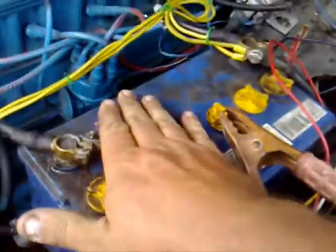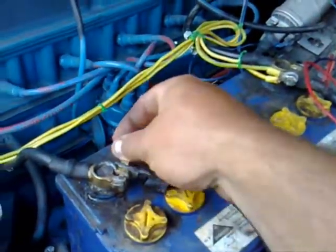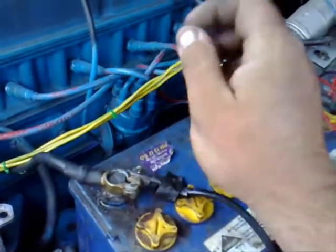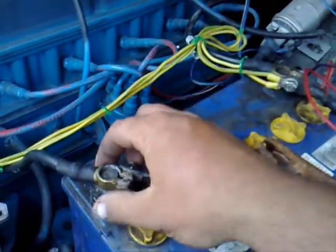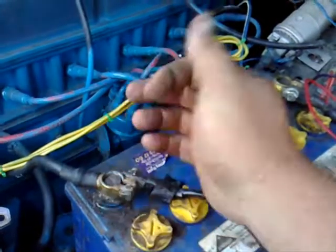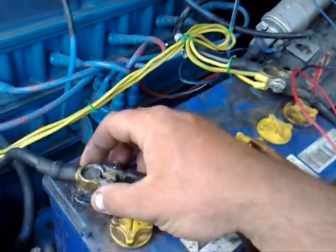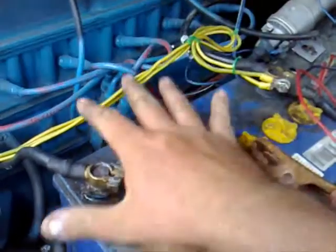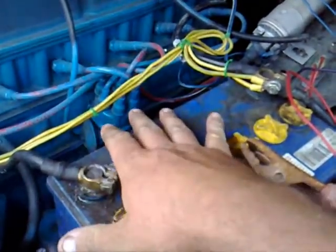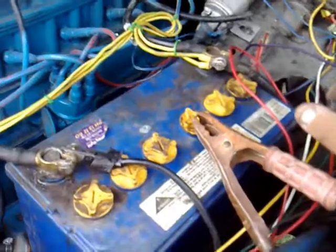By this stage, check to make sure your battery terminals are tight and that there's no corrosion on there. If there is corrosion, depending on the terminal get usually a 10mm, 12mm, or 13mm spanner, undo it, and lift it off. If you haven't got to touch it, wear a glove if you wish. If it's got a build-up on it, it won't hurt you — just don't rub your eyes with it. Take it off, pour hot water or hot water and bicarb over it and it will clean it up perfectly. Throw it back on, tighten it up, and check the other one.